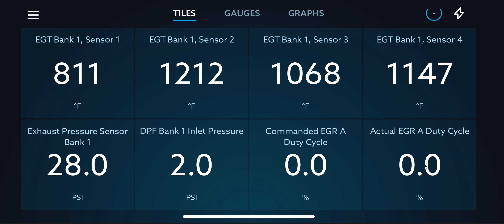I wish it would go to a thousand miles like the RAM, but 500 miles is okay. If it stays at 500 miles consistently, I can plan around that and ensure I'll be on the highway for the next regen cycle. This first regen started at 572 miles and ended at 586 miles, so I can expect my next regen cycle somewhere around 1,080 to 1,100 miles, and I can plan to be on the freeway driving a good distance to complete a full regen.